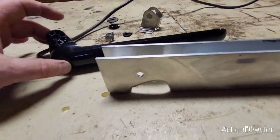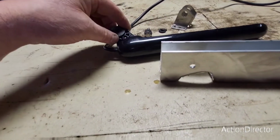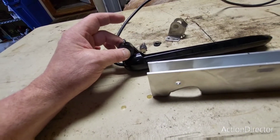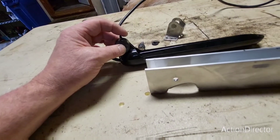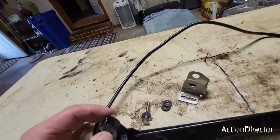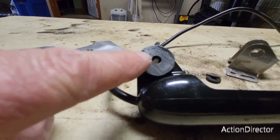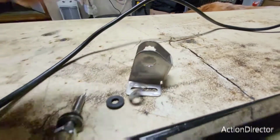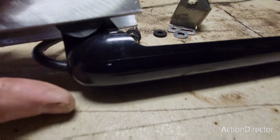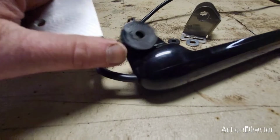So one of the main modifications to the factory items of the transducer is this little star keeper here. Now this little keeper on the back of your boat would work as a slip joint, so if you hit something it would move out of the way. Plus you'll see right here it has the cable retention. Well, wouldn't you know that that thing with the little star, the external star, which would go into here, sanded off flush, that thing became a 1-to-1 fit inside my channel. Absolutely perfect. So let me go ahead and get this assembled.